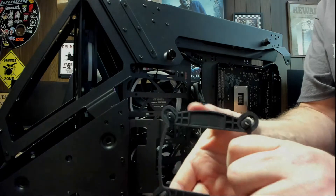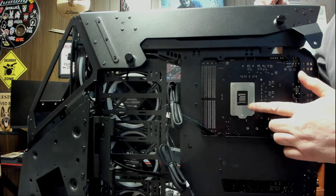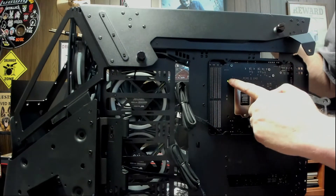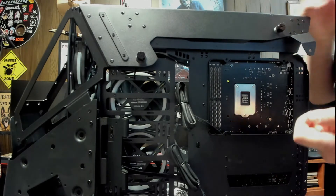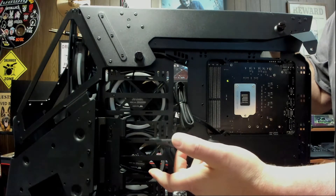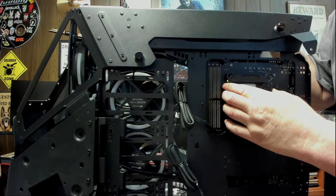On the back of the motherboard — this is where we installed our CPU, this is the back side of it. You take this backing plate and there are four holes in the motherboard — one here, one here, one here, and one here. Those holes are there to accept this backing plate. You can see the pins on that backing plate — those pins fit through those holes in the back of the board. So we're going to put this up here and line those pins up with those holes.